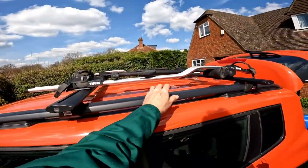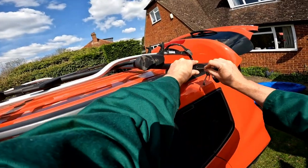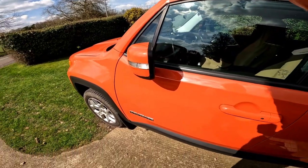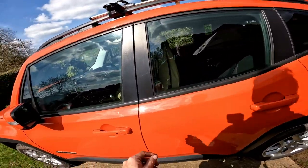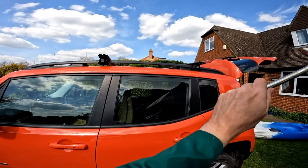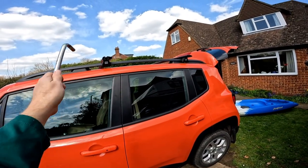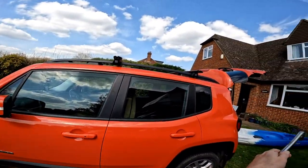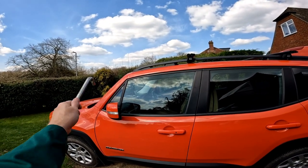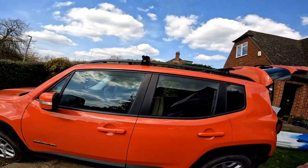Now I need to get the roof rack for the bikes off. Now you'll see at the moment the roof bars are fairly close together — that's necessary for that bike rack. But I want to move this front roof bar as far forward as I can so that I've got as much length between them as possible, because that's quite a bit of leverage with that long kayak. I don't want that trying to lift up. I don't use a bow or stern rope to hold it down — that's just going to rub the front of the car. If I use ratchet straps and they're well spaced apart, I'm not going to have any issues. I've certainly done up to 70 miles an hour with it on the roof with no problem.